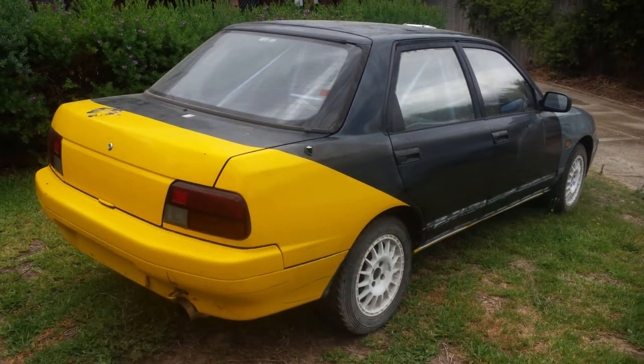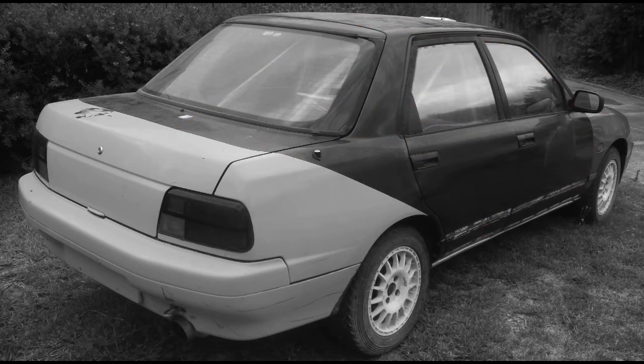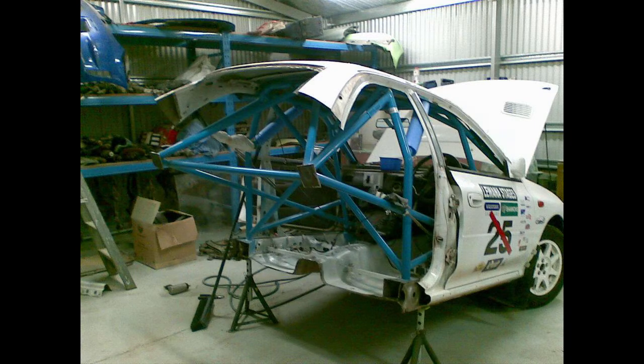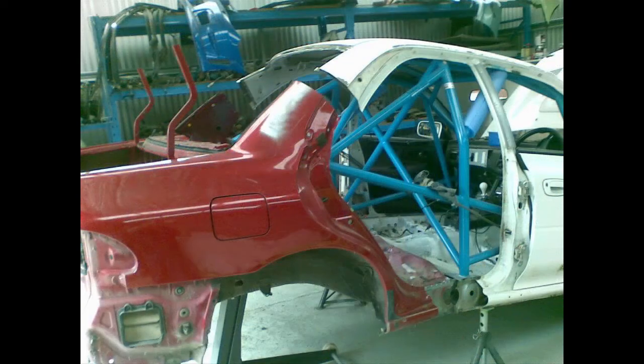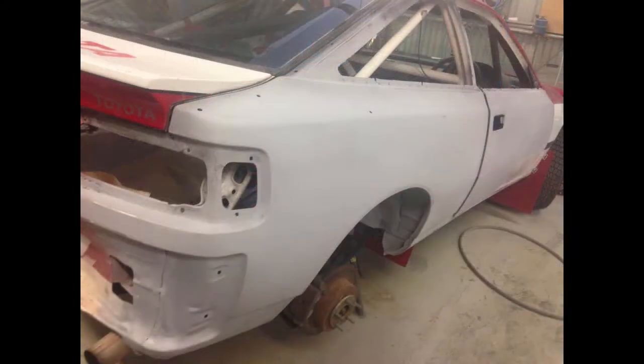Take a look at the roll cage next. It's the single most important safety item fitted to the car. It's integral to the structure and rigidity of the car. All cages will have a minimum of 6 points. Front, centre, and rear. Many cages will have more than 6 points, particularly if it is a tower-to-tower welded-in cage. This type of design is very strong and can help the body shell of the car survive some very heavy shunts. You do, however, have to check the cage carefully.